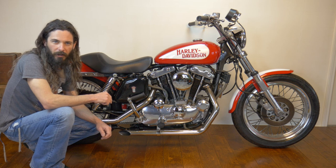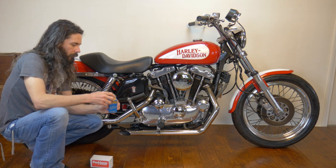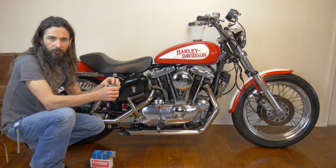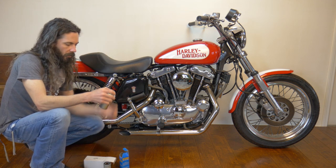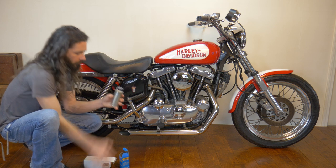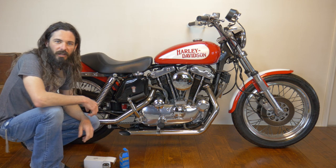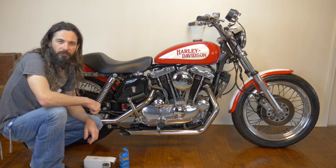I'm going to install the oil filter now and I'll show the two different types that fit this application. This is the original factory oil filter — just a canister that slides down into a container inside the oil tank. And this is the unit type that has the canister and the container as one unit. You can see the size difference. We've now changed the engine oil and the engine oil filter, and we'll go around to the other side of the bike to change the transmission fluid and the primary fluid.